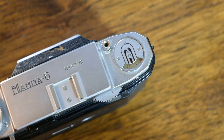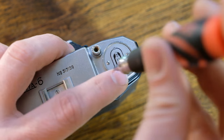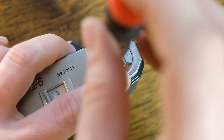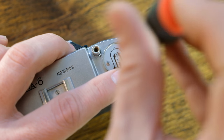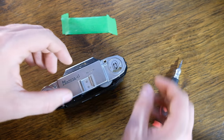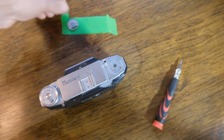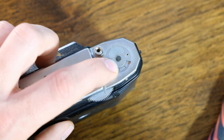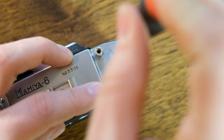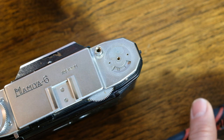To start, over here at the distance dial, you're going to want to take these two screws off. You don't need to totally remove them from the dial — just get them so they disconnect from the camera body, and you can pop it off. Underneath is another screw which needs to be removed. It's just another flat screw — get your screwdriver in there, give it a twist, and stick it down. That's all you need to do on this side.